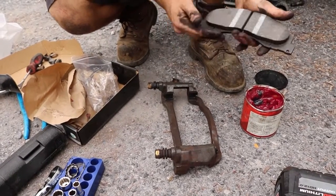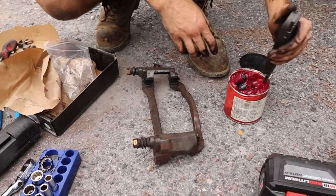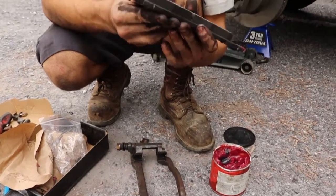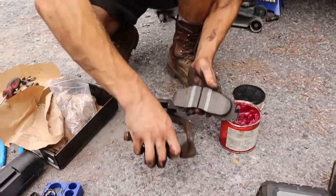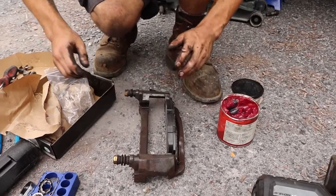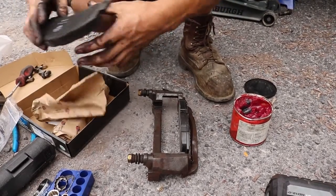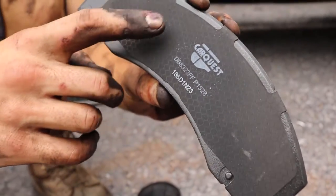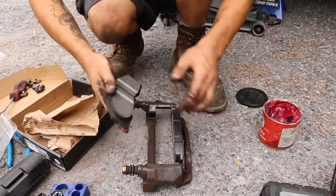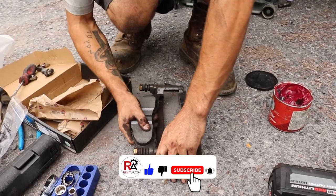A good rule of thumb for the brake pads is the contour on the pad. I always line up with the contour of the wishbone of the caliper. And I'll take a small dab of grease, something like that amount there and that amount there. Too much grease will work its way onto the rotor over time. So I go and I install. I will clean all of my finger oils and motor oils off of my pads before I install them. And these pads, take note, are not directional. Some pads will say left front, right front. Depends on the vehicle or the brand. So always take a look at your pads and make sure that you're putting them in the right locations. I'll set them in like this. A little tricky sometimes.